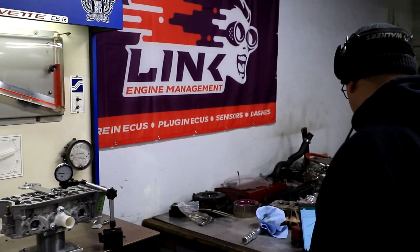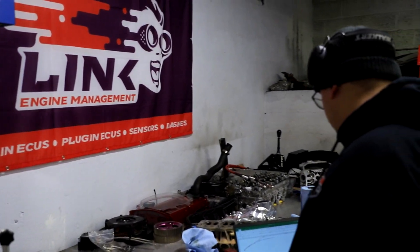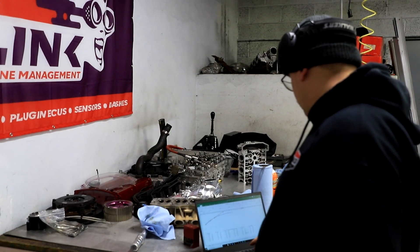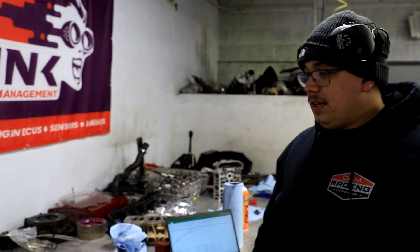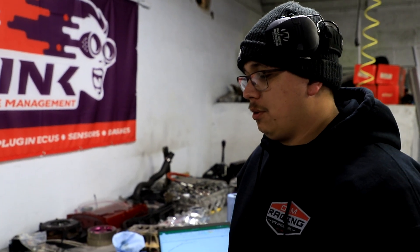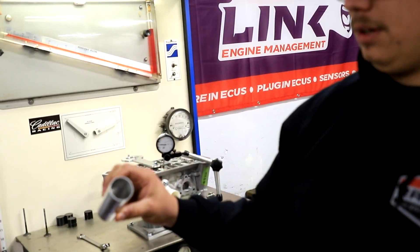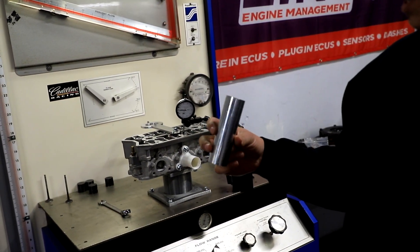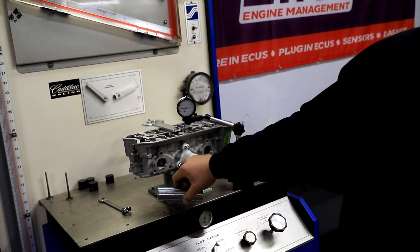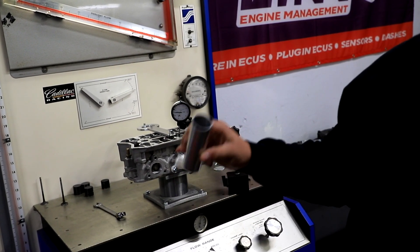120. Interesting — 129. So I flowed this with a tube — it's a much bigger diameter, like that thing slides over it. So this definitely lowered the flow of this port, because I know what it flows with the smaller tube.